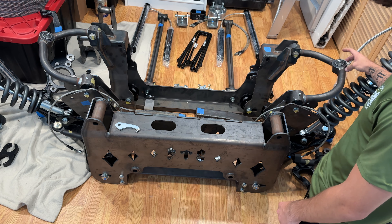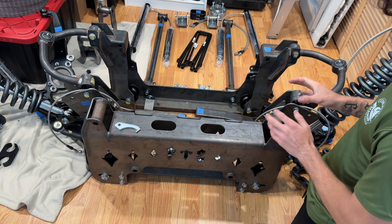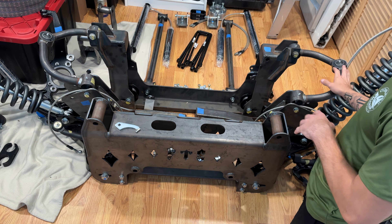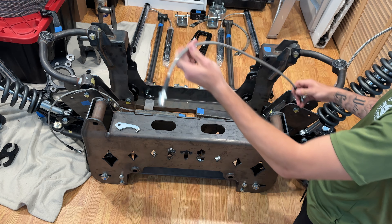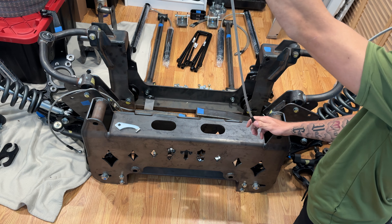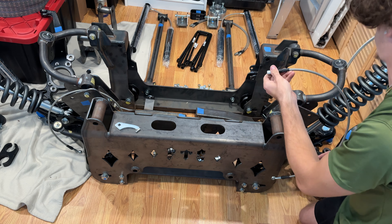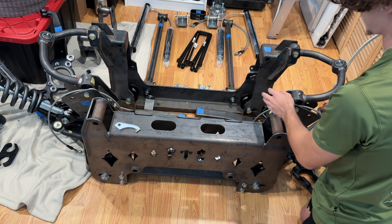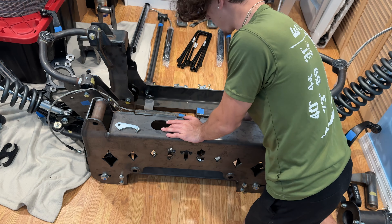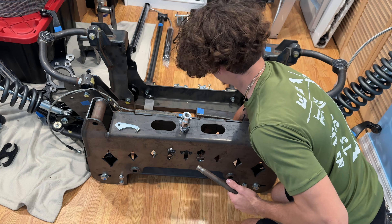It is not like a Bulletproof lift kit — it drops further than a Bulletproof lift kit does with their upper control arm drop brackets. By dropping the upper control arms that far, I'm not going to have to use ball joint spacers or any of that. As you can see, normal ball joints, no ball joint spacers, no anything, because this bracket and this drop-down bring all the angles back to factory.